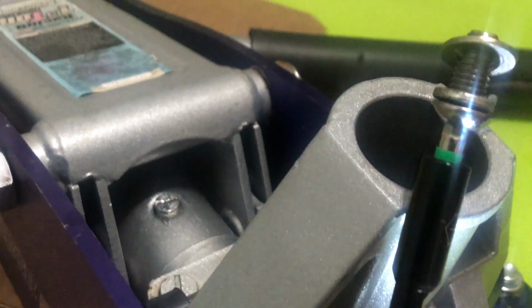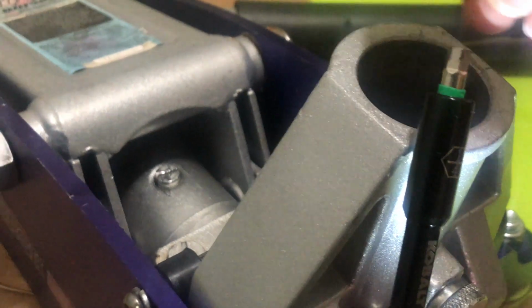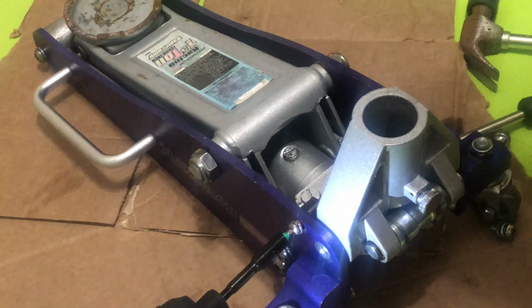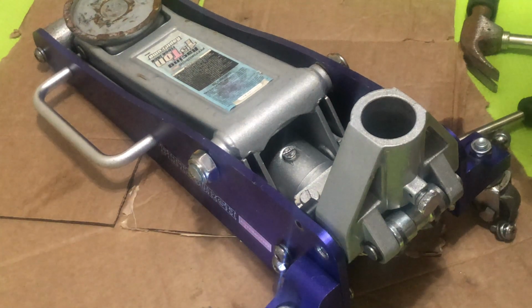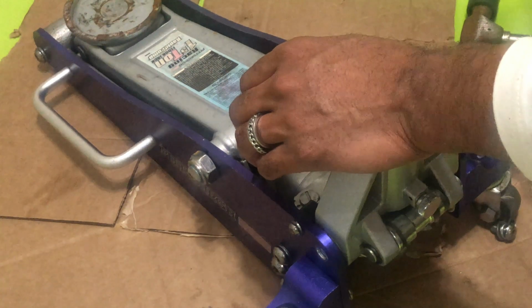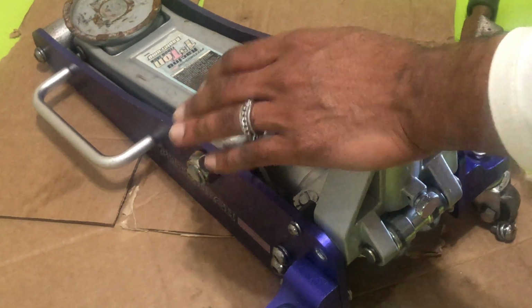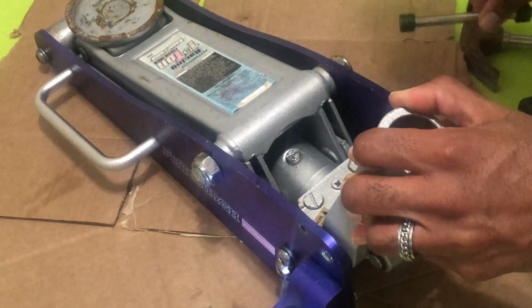The yoke is what we want to maneuver so that we can get in contact with the springs and everything underneath. These 2 bolts we'll have on the left and the right, and this will help us to be able to pull the yoke all the way down to get a hold of the pistons and the springs. So we would just extract the rod that's right in front of the yoke, and now we can get even closer to the pistons.